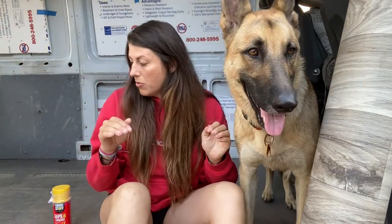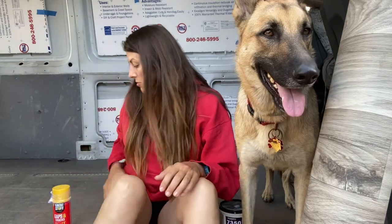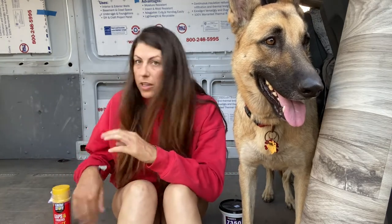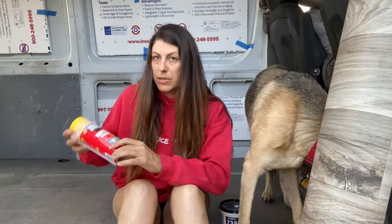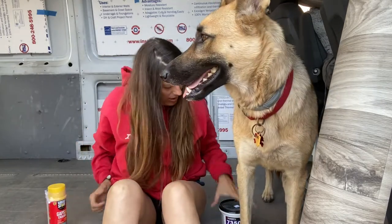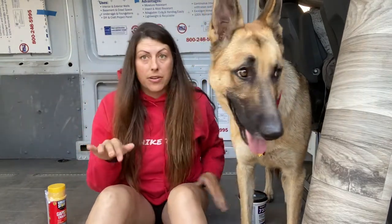Basically what we did was keep the original flooring in the Sprinter — it's a cargo van, the 3500 edition, so it's huge — but we're really only going to do flooring from the bed all the way to the front, because the garage area doesn't matter. To prep, there are little divots, and we filled those in with a gaps-and-cracks filler. Then we're going to lay down the universal flooring adhesive and put it down and let it set.